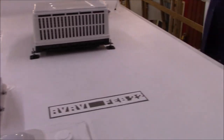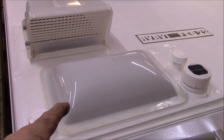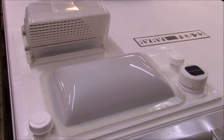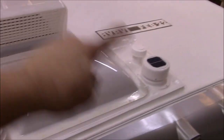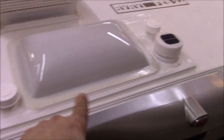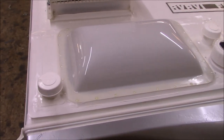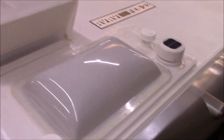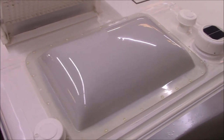These are commercial roofs, so there's no reason you can't park them outside — that's your option. Some people want to put them under a carport, but I'd rather see them out in the sun, because even under a carport you're still going to have that condensation issue. You can see in here some people put screws in these — we do not put any screws in them anymore. If you replace your own, you have to use a really good adhesive. These lenses expand and contract, and when they do they're either pulling or pushing on a screw, and I've had my fill with cracked lenses.